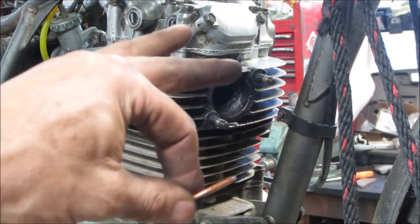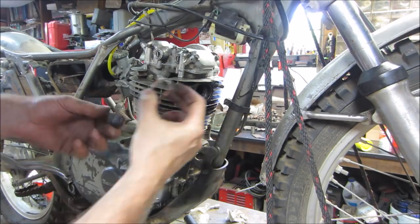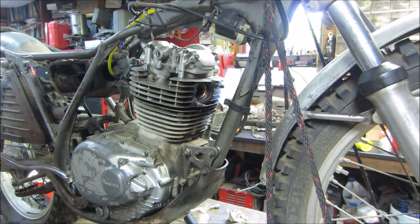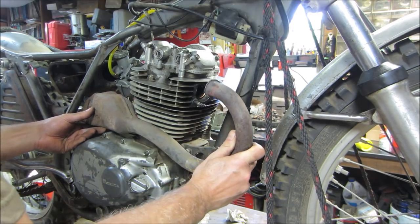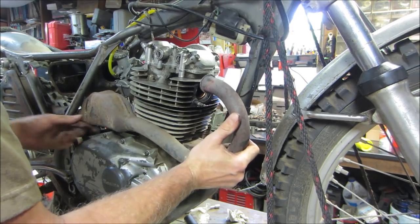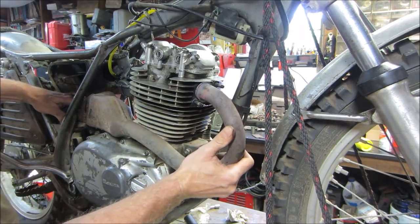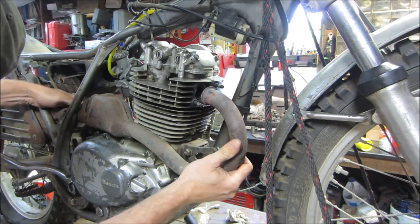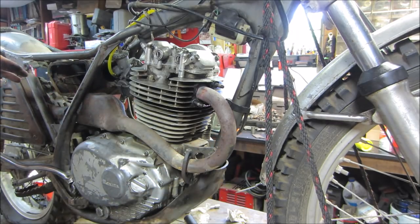Let me go try putting that pipe on. That pipe is going to be about a quarter inch shorter, but it should just slip in. I figured just slip into the muffler that much further. Put some grease on it, help hold it. Later on, when it's smoking, gives us something to blame it on, right? All right, so we need to move this assembly back in there again. See, we didn't alter it that much, did we? Let's get that up into place. We need our two halves.